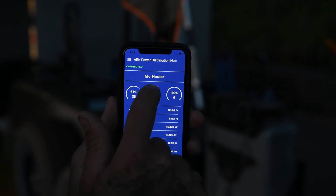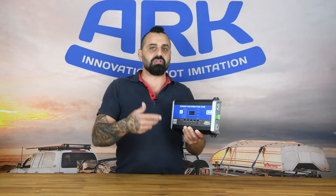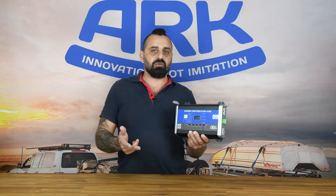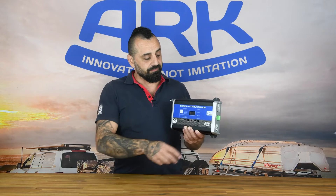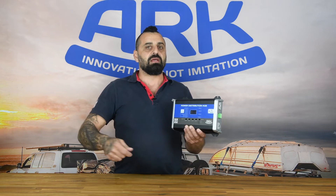There is another feature of the unit which allows you to override the low voltage cutoff protection, which is a no protection mode. You would typically use this in a situation where you want to run an air compressor. Air compressors put a large spike into the system and lower the voltage of the battery quite quickly, so your normal voltage protection would tend to cut that out. By utilizing the no protection mode to override that function, you can use that compressor or high current device, and then go back to your preset selection after that.